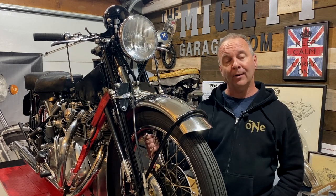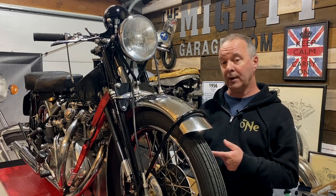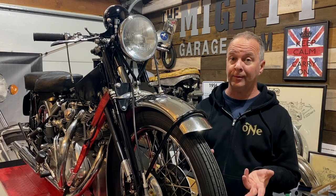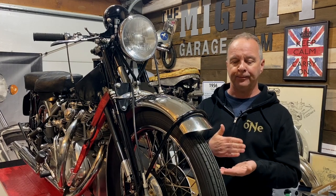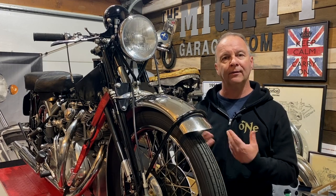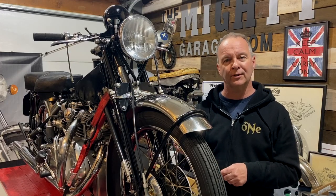In this video I'm going to be looking at the timed breather. You may remember from previous videos where a lot of oil was getting sprayed all over the bike through what I believe is the timed breather. I thought perhaps it wasn't functioning correctly, but that might not be the case. I think the banjo just simply wasn't sealed properly, so I'm refitting the banjo with a slight modification, taking this as a process of elimination — a step-by-step methodical approach to see if I can fix this, whether it's a breathing problem or just a sealing problem. If that works, terrific; if it doesn't, we'll move on to the next solution.